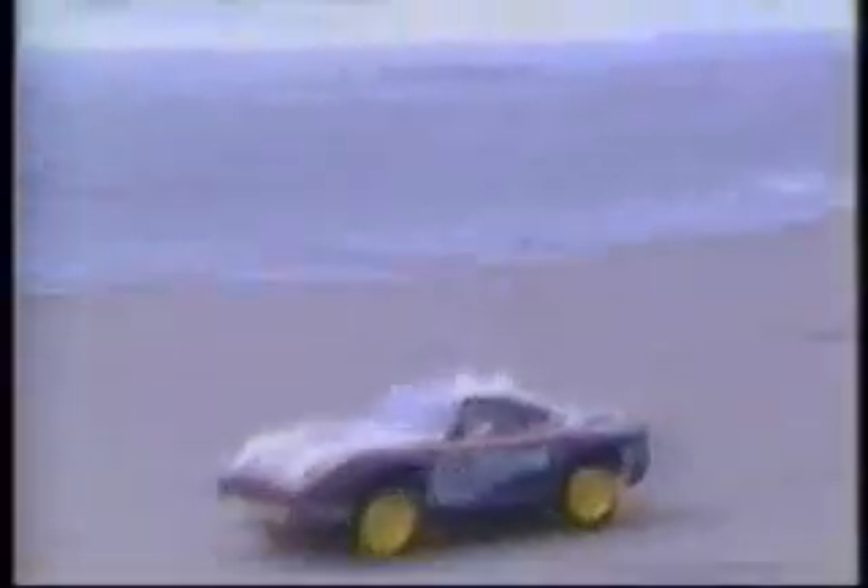A state-of-the-art chassis — the monocoque chassis is completely new in design and made from light and sturdy engineering plastics. The sophisticated independent double-wishbone suspension system is damped by four large coil springs and four oil-filled shock absorbers, each with its own surplus oil reservoir.